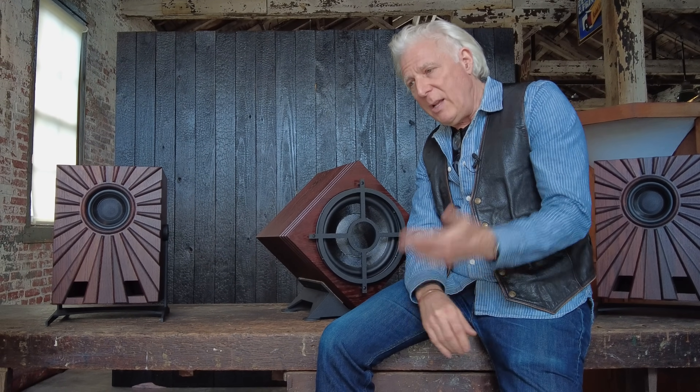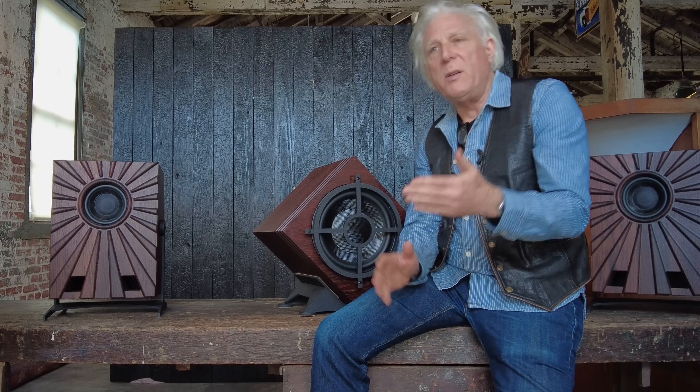And they don't work with our speakers at all. When I go to installations of high-end audio, a client just last week had the mini speaker with a sub added, and it's a disaster. Because the mini woofer is super fast and super efficient — on a drum strike it goes in and out like this. The subwoofer goes much slower. So now the bass note that the mini has produced, the subwoofer is still producing it, and you get a blurring effect. Imagine watching a movie where everything is blurred — that's the sound of a system with a conventional high-end consumer subwoofer. Awful.